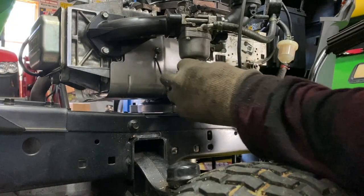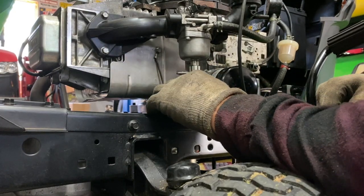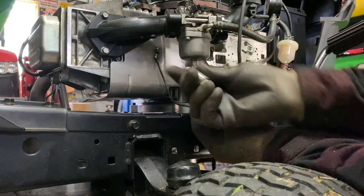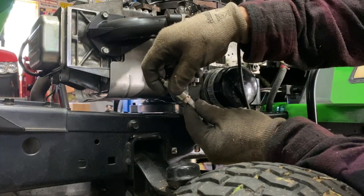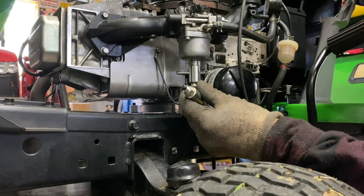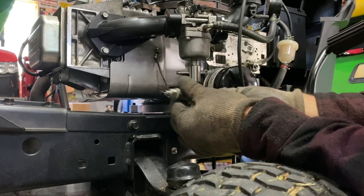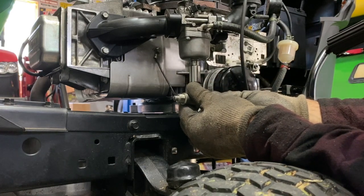So this fuel shut-off right here — on, off, on, off — it clicks. But I tried it 10 times and I didn't hear it click twice. I'll plug this one in, put the key on — boom, on, pulls in. See right there — off, on, off, on. Look at this, just by wiggling that back and forth.